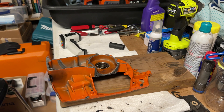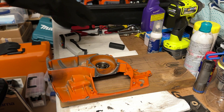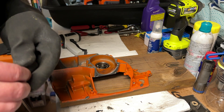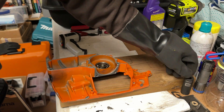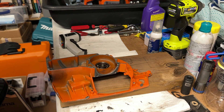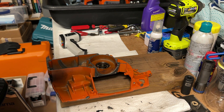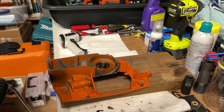I made a bit of an amateurish move there on that first half. I didn't check the temperature on my variable temperature heat gun and I only had it set at 280 — that's just at the nozzle, so that's why I couldn't get it very warm. As soon as I cranked that up to around 500 degrees I was able to very quickly get it up to 280 on the crankcase. Plenty warm enough — you saw how easy that bearing came out.